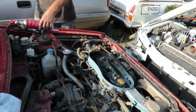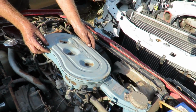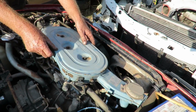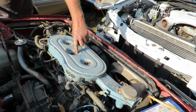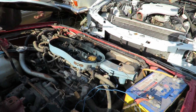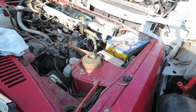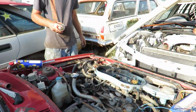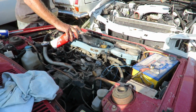Yeah, it's more that, because of where that sits on there, and that centre nut wasn't tight, the nut sits in there. So I'd say you can actually see where water's been sitting in there, and it's run down the thread of that and straight into the carby. So hopefully that's all it was, because it hasn't rusted the bores too bad, because it seems to wind over quite easily now. So have you got throttle?